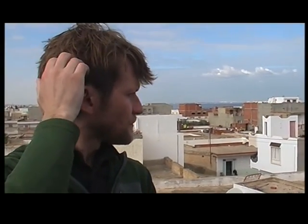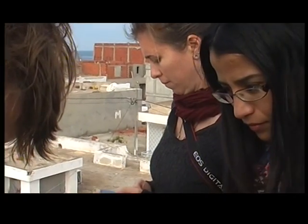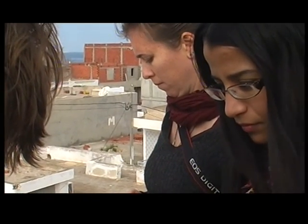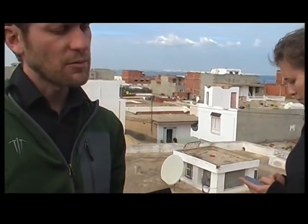Can you say again the signal range that you look for? Yeah, the signal range that is best for the connections is above negative 70. So if we look here, many are negative 90, negative 80, negative 79. Those are a little too low. So we really want the signals to be above negative 70, and then we will have a strong connection to the other mesh routers. Anything above negative 70 is good.